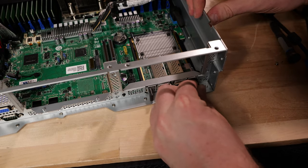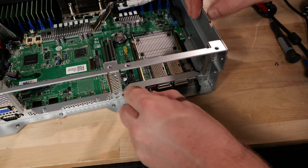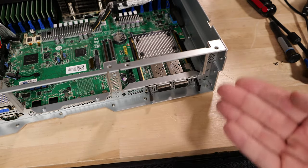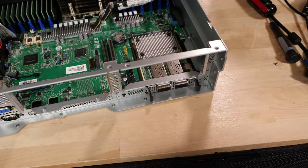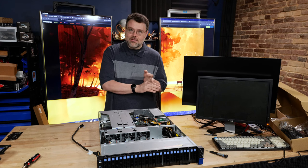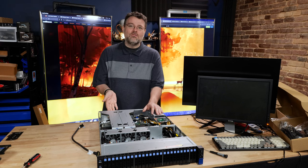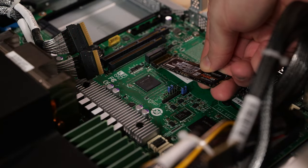It really isn't that expensive. Your PCIe Gen 5 X16 OCP3 slot here can easily do 35 gigabytes per second, just the raw connectivity. And you've got another X8 slot on top of that. This is pretty much the perfect configuration if you're going to go for some dual use case where you've got both InfiniBand and regular old Ethernet. You shove a regular old Ethernet card in your X8 PCIe slot, and you shove an InfiniBand card in your OCP3 slot, and you've got the best of both worlds at over 32 gigabytes of connectivity.